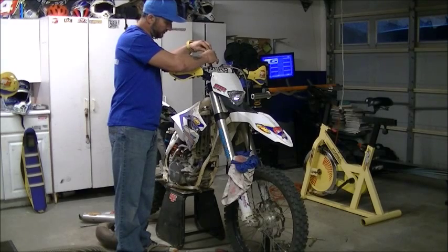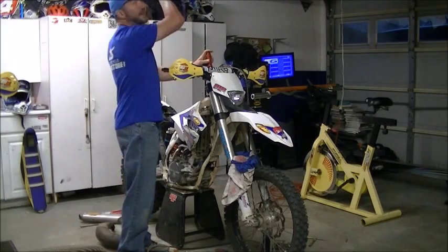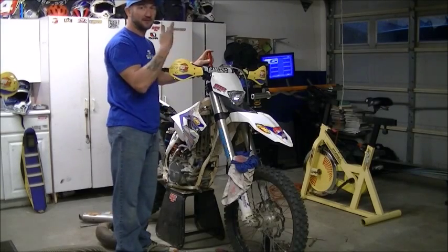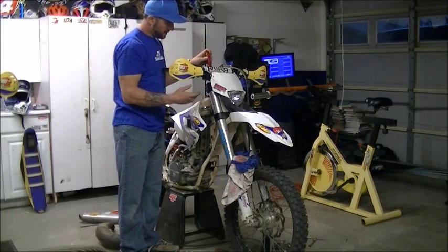And just go out real slow. Real slow to where you hear a little bit of air release. You're going out, but you're holding a little bit of pressure down on the screw, because if there is pressure behind it, you don't want to blow it out and have it take off. I've seen that many times where it's blown out, taken off, and then you can't find the screw. So then you have an issue. So you're going out real slow to relieve some of that pressure.